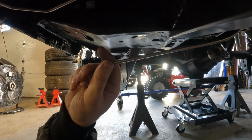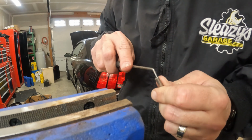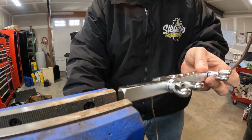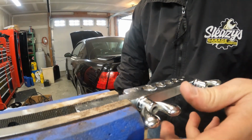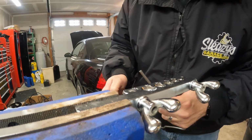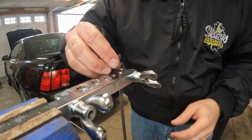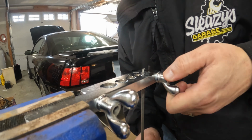our first ever flare. All right, so after cutting, this leaves a slight little burr. So I'm gonna knock that off a little bit. All right, so these are 3/16 lines. Also, I almost just did the thing I'm not supposed to do. Before you flare, put this thing on first. I don't really know what I'm doing. I'm kind of just following what I saw on the internet. So we feed this through until it's the same height as the button. I think we're good there.